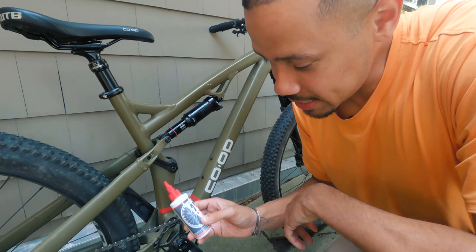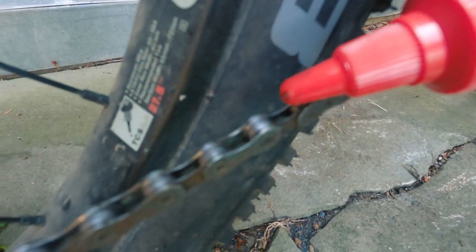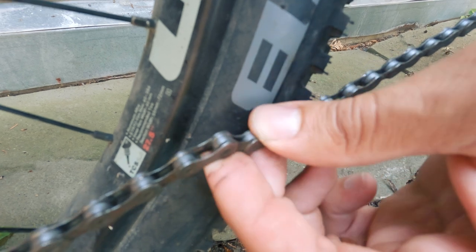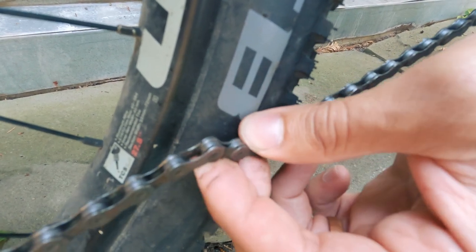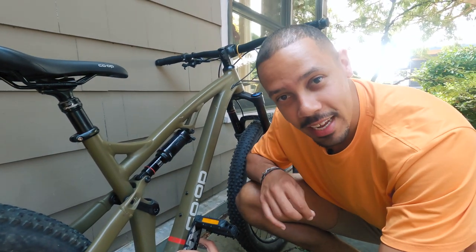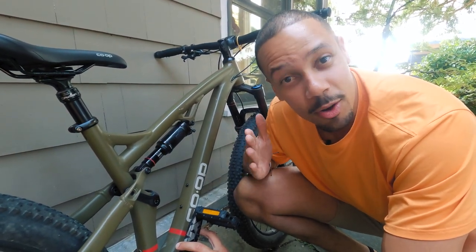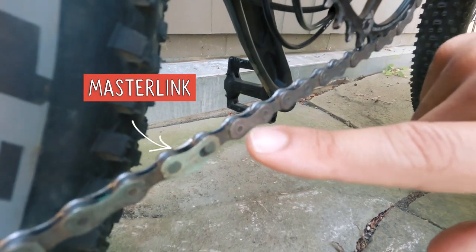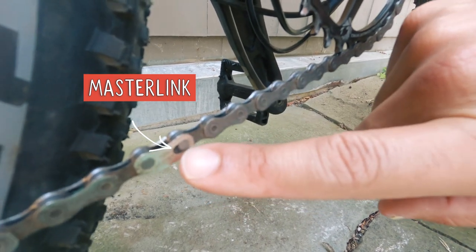The way I do it is a little particular, but I think it's the most beneficial for the chain and the least wasteful. I take my lube and put a drop on each and every single one of the pins of the chain — the little bars that go across. The only spot that needs lube is right inside of the pin area, because that's where the chain rotates and articulates. You want this process to always be nice and smooth. To start, I find the master link in the chain because it's an easy start and stop point. The master link is the one where all the others just look like a hole straight through — this is the only one that has a space for the pin to slide back and open up your chain.